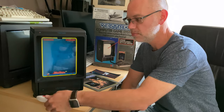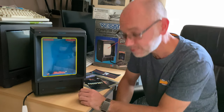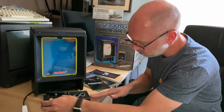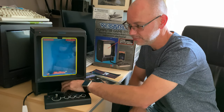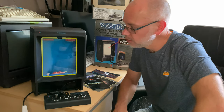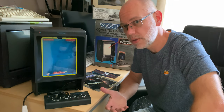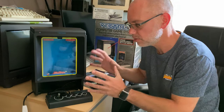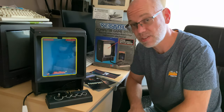To see how this thing is going, I've plugged it in. It has got an aftermarket power lead on it, and I think that was a modification that a few people did. The controller flips out from here, and then you have a volume power knob here. It sounds like the logic's working — it's got sound, it's got audio. The game itself seems to be working. There's two boards in here: a logic board and a display board. But there's nothing coming out of the display, so let's see what we can do about that.